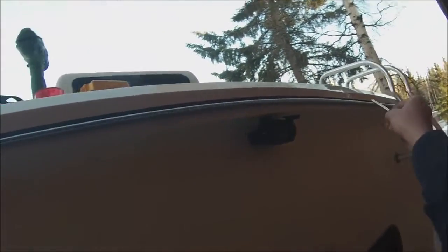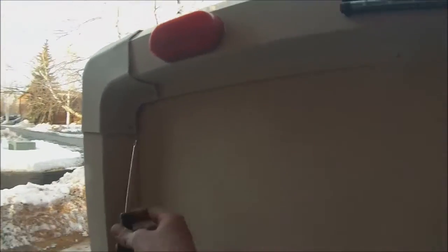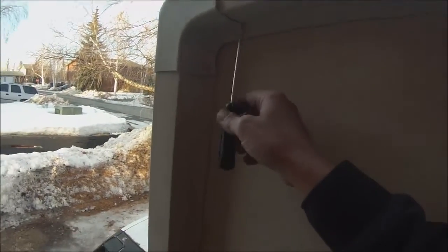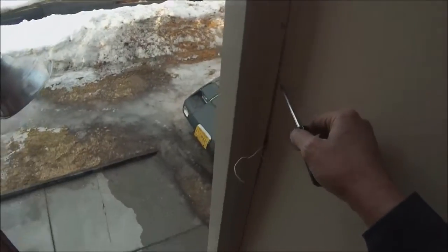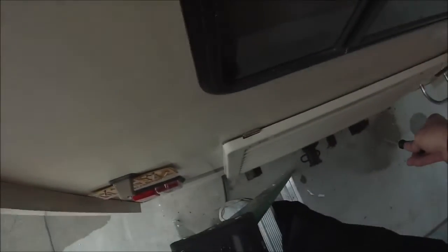So I wired up this 60-inch LED brake bar, drilled a hole through here, ran a coat hanger up through there and fished the line through. So far I've run it all the way down to here, and I'm going to run it down to the trailer lights down there. Then these should work. So I'm just finishing up and screwing everything in.